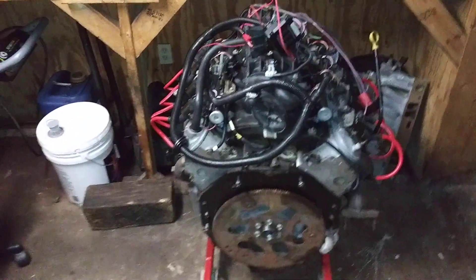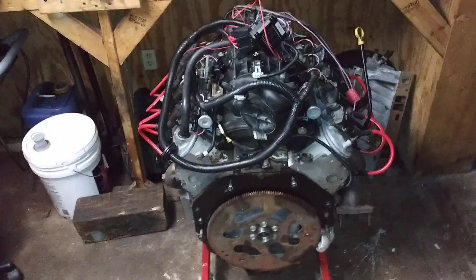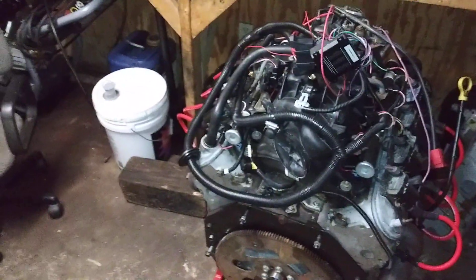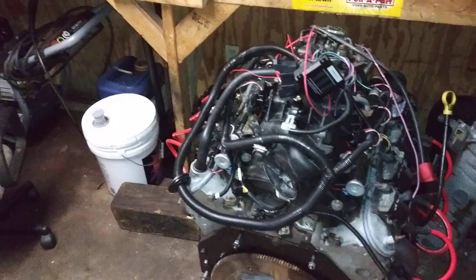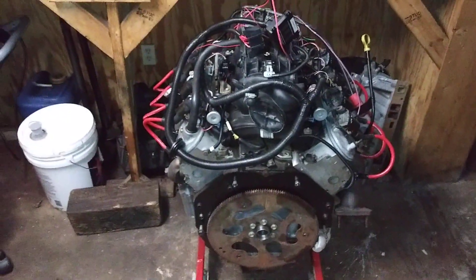It's EFI Source — you go under engine management, maybe micro squirt packages, and he's got a whole bunch of different ones. He offers a micro squirt package for a standalone like a 4L60 or 4L80 transmission. He can use the small controller to control the transmission function in those transmissions.